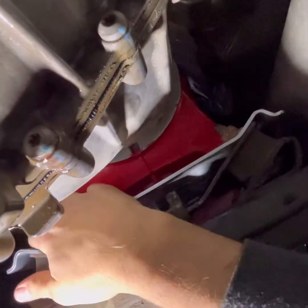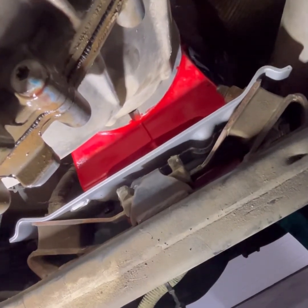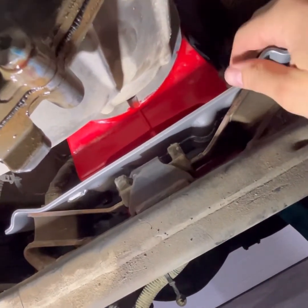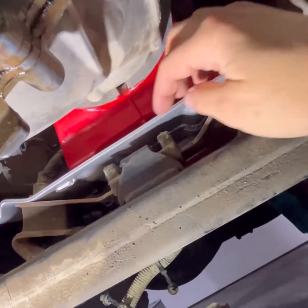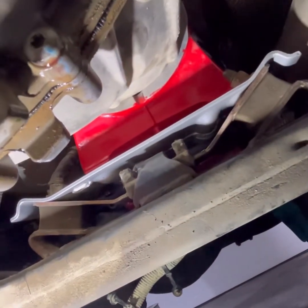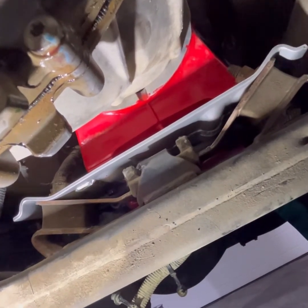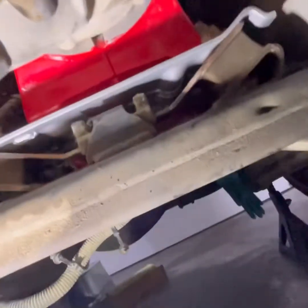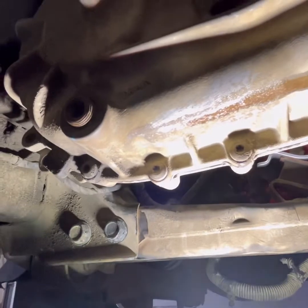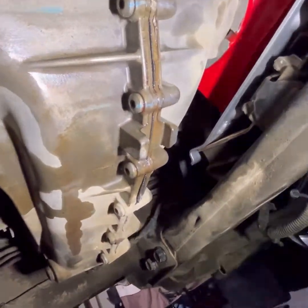This stud here and this stud here, I believe in the 68RFE it's an M12. In the G56, I think it's an M10. So these holes on this bracket that I painted silver, they wouldn't go in. So I used the reamer and a little deburring tool just to make them a little bit bigger. And yeah, so the big thing is getting the wiring done now. Everything went good as far as the transfer case going in. It is an automatic transfer case, lined right up.